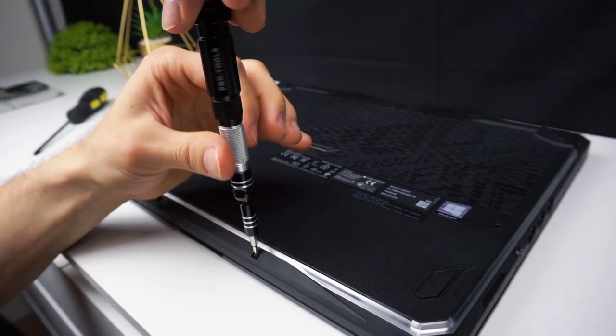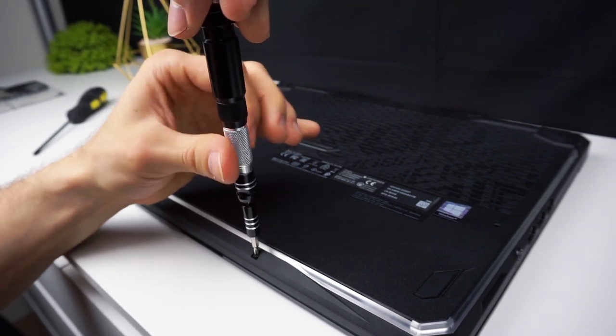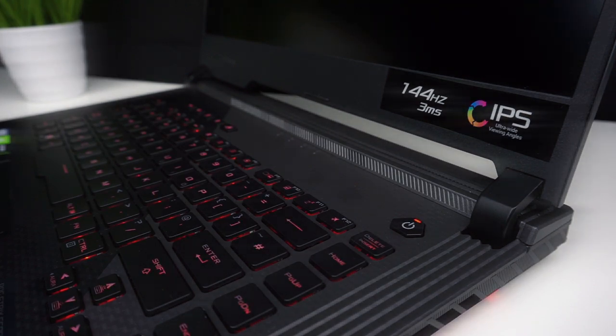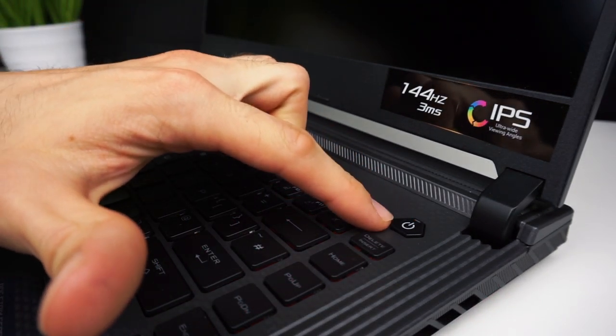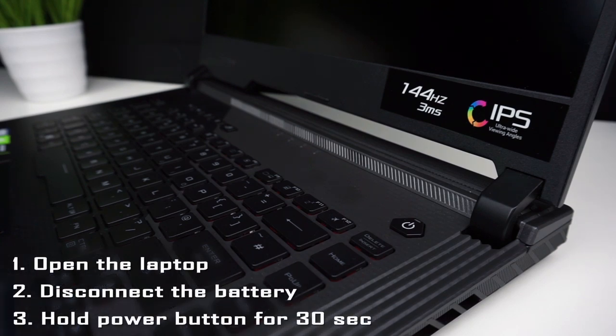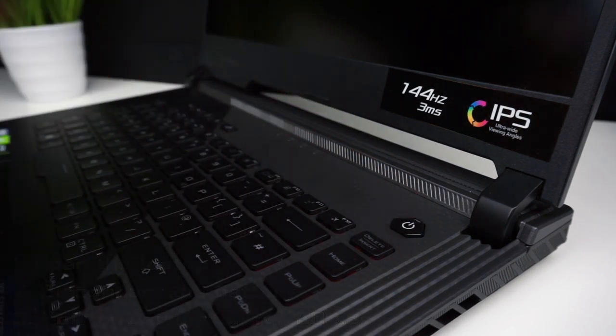For some of you this is the end of the job, but my laptop didn't want to turn on — the screen was all black and the power button LED with keyboard were blinking. If you have the same problem, follow these steps. First try to hold the power button for 30 seconds and check if the laptop turns on. If it didn't help you have to do a hard reset. Open the laptop again to disconnect the battery, then hold the power button for 30 seconds again. Connect the battery, close the lid and your laptop should be working now.